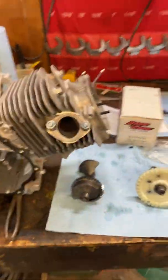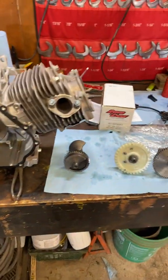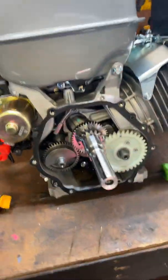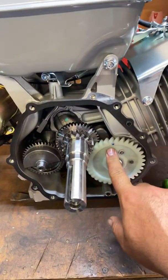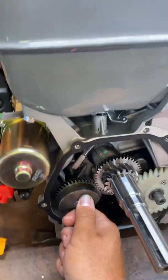So I figured maybe that's the big difference between the Princess Auto Power Fist and the Pro Point. I've got the Pro Point on the bench all torn apart, and yeah, it's the exact same - the numbers on the cam are the same, it's got the same plastic tooth with the huge gears. The balancer is the exact same, the crank is the same, the head is the same.